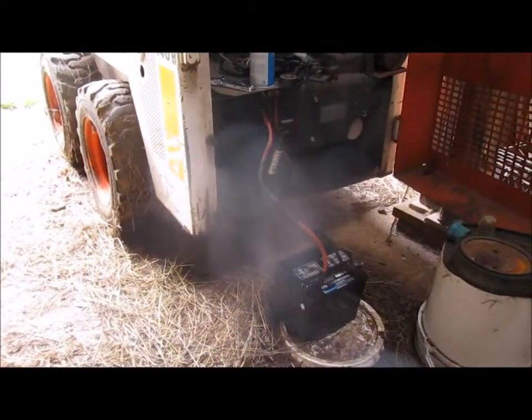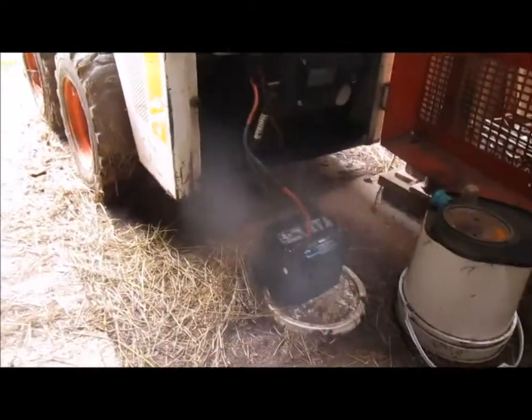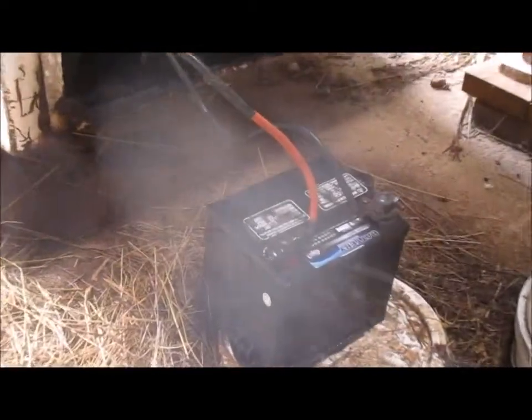I went to unhook the battery thinking it might be a bad battery, but I just bought it last year — don't think it's even a year old yet. So I started fiddling around trying to find the issue. It turned out the issue was with that starter relay right there — the positive post was wiggling and must not have been making good contact, which could have been the issue from the beginning. Once I messed with it a little bit and got back in, we shot a little starter fluid in there and it started up. Now everything's tightened down and taped up.